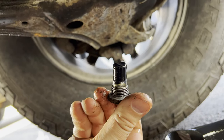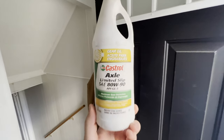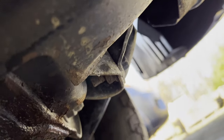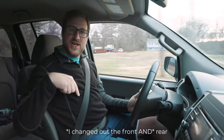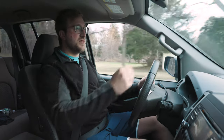I used Castrol 80W90 for the front differential. Over in the front right now I found the bad sway bar bushing — we'll replace that and it should be a lot quieter. I did change out the sway bar bushings, but there is still some clunking over bumps. I've never had a car with leaf springs before, so I'll need to troubleshoot whether that's what's causing the clunking noise.